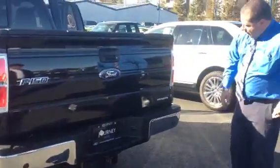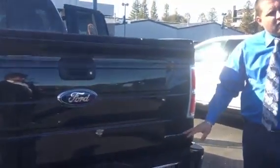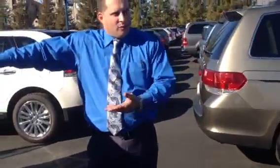Okay. Now, see this flex fuel? You know what that's about? Do you have any idea? I've heard about it before. So yeah, it's basically where your engine is compatible with E85 ethanol-based gasoline and regular gas, any blend of the two. So if gas prices went way up in a few years, you wouldn't have to trade your vehicle in to get something that can run on ethanol-based gasoline.